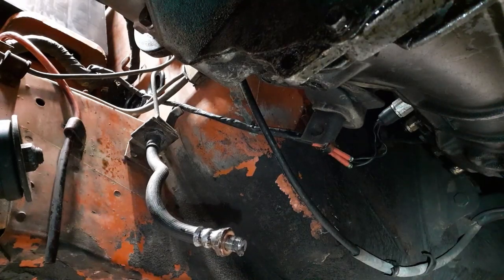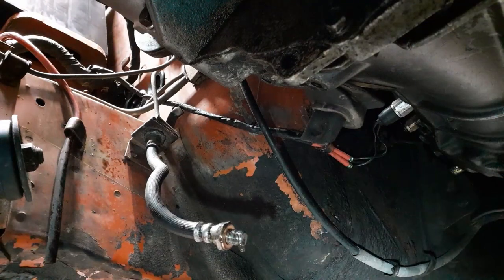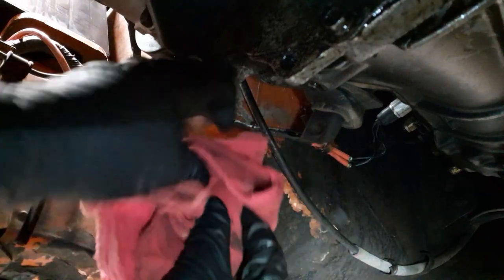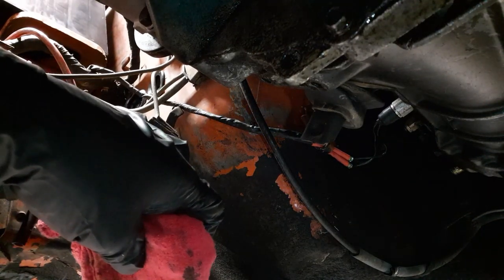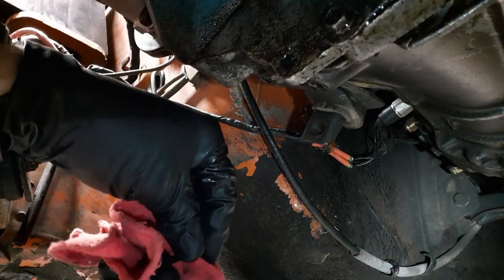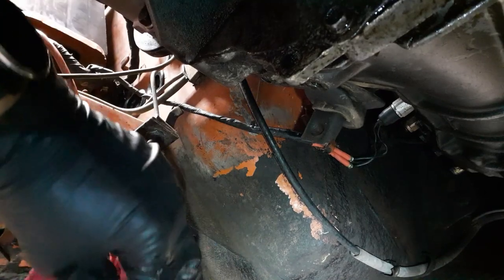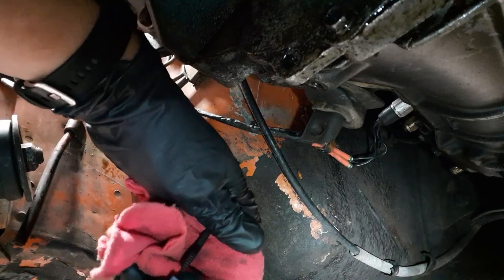So what I'm gonna do next is I'm going to tie a rag around here and push some brake fluid through and some air through to kind of make sure everything in this line is cleaned out from having that old brake fluid. Okay, now to wrap this around. There we go. And I'm going to see if I can't tighten this enough. Let's see. There we go. Hoping I can get this tight enough that it... Come on, zip tie. Nope, I got it backwards. I thought so. 50-50-90 principle. 50-50 chance of getting it wrong. 90% of the time, it will be wrong.